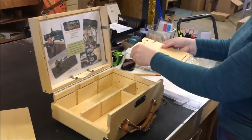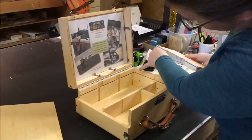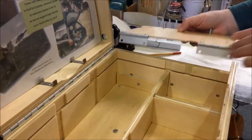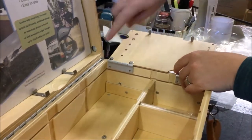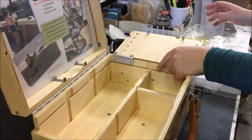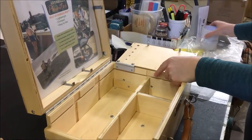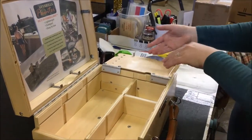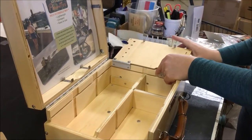So I know that's going on that side. This one is going to go on this side — I've got my brush spacers at the back. In the box there are preset holes. They're not going to be visible on the video, but there are some preset holes that tell you about where you're going to screw this in. Before you start screwing it in, I would recommend that you find something to support it so that it's not flopping down and it's basically where you're going to want it height wise. Then start screwing it in.